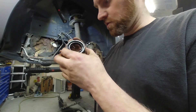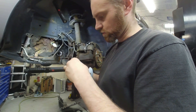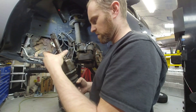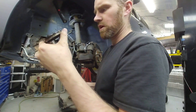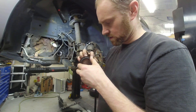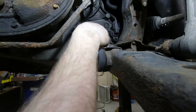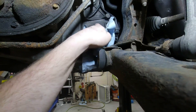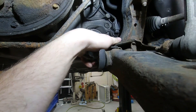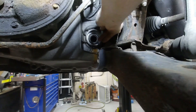Now that we have the seal out, the first thing I'm gonna do is inspect it — I'm not just gonna throw a new one in right away because I want to see what actually failed. This seal actually appears to be in okay shape, which is unfortunate. I'm gonna slide it on the shaft here and see how it fits. It actually fits really well, but I just noticed the seal is wet all the way around, so I'm wondering if it's the case part of the seal that's leaking. We have a lot of heavy corrosion here so the seal has probably been pushed out slightly. I'm wiping this out and inspecting for scratches. A perfect tool to clean up that kind of corrosion is a super scraper — I'll throw a link below.